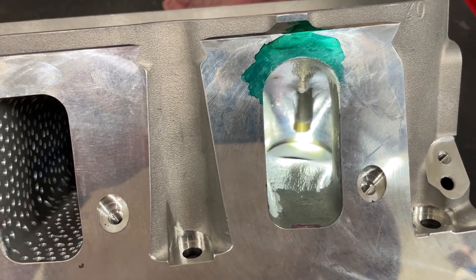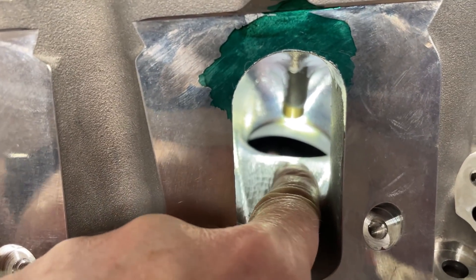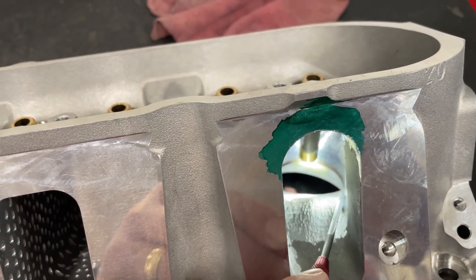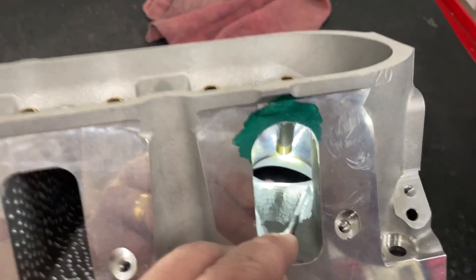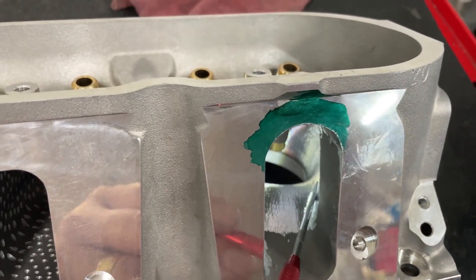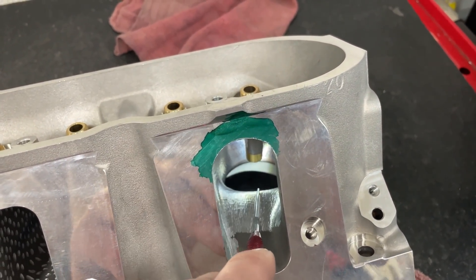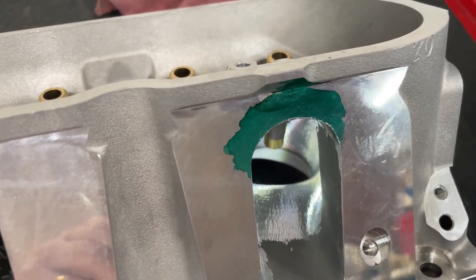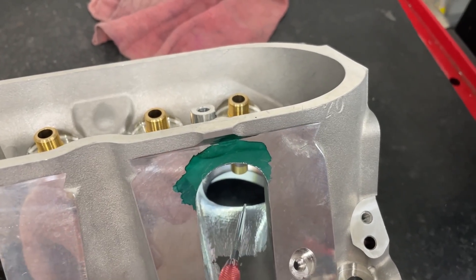I pushed that wall over like I just said. You can kind of see it - it looks like I dropped the top of the apex of the short side, but not really. When I'm grinding here it leaves a little notch because I'm pushing the wall over, so I blend it to avoid a dip followed by a rise. I probably did take off maybe 10 thousandths just to get a smooth transition. I still haven't touched the short side and I can tell it's pretty much straight up - it needs to come back some. The short side height itself is too short for this port.